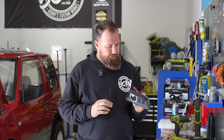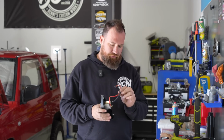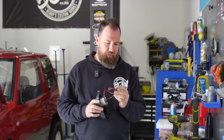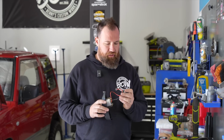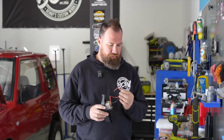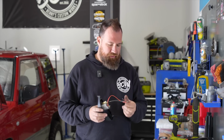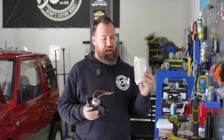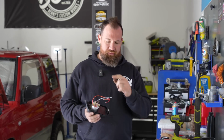We've got our GFB boost gauge mounted up now in the original altimeter multi-combo housing setup. I have just run a short section of vac line with a, well, this is actually just a piece of brake line, hard tube. You could use a vac line joiner if you wanted to, but this is probably the most compact thing you're going to come across. The reason I've run this joiner is because the back housing is going to cover where the nipple is on the gauge. So I've run this piece so that it'll tuck out of this housing and mean easy installation and removal when it's in the car.